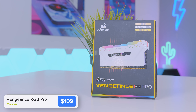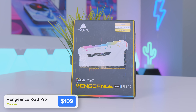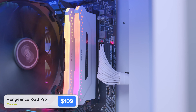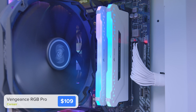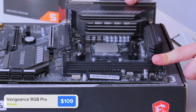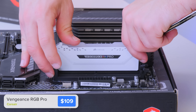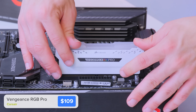We're pairing the CPU with 16 gigabytes of RAM from Corsair. One thing to note about AMD processors is that they like fast memory and dual-channel memory — the extra bandwidth and speed is fantastic for performance. This 16-gigabyte kit's white aesthetic will also match the case really nicely, with RGB up top that looks frankly awesome. I'll link the latest pricing and availability in the description below.